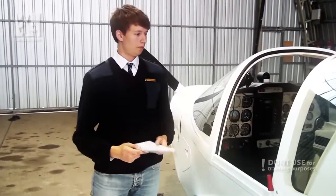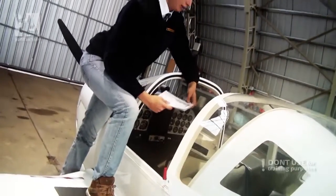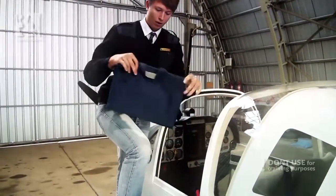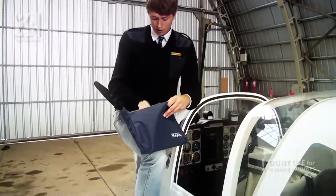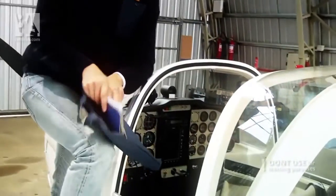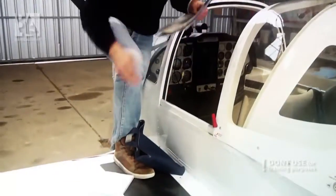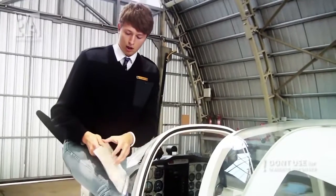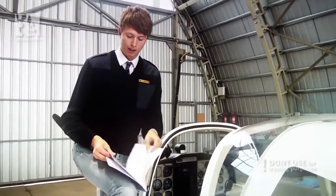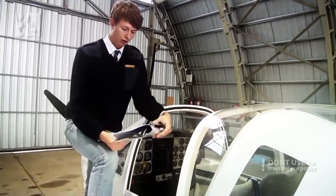We'll start the walk around from the cabin. First thing we check is that our parking brake is on. Next thing, flight manual and aircraft documents. We check that we have all the appropriate documents and the flight manual on board. As for documents we have to have airworthiness certificate, insurance, everything we can find here. Next thing we check is weight and balance, if it is within a predetermined limit. I'm pretty sure it is within balance limits because we have no baggage at all and I will be the only person flying, but should we have any different configurations we can always check the sheet.